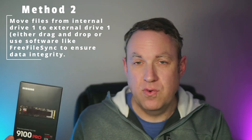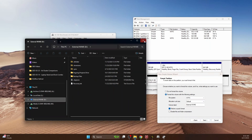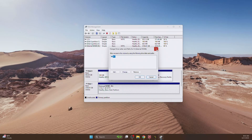I use Windows, and before I could use this I did have to go into the partition manager and partition the drive. When I did that I gave the drive the same name as my existing drive, transferred the files over, then installed it in my computer, took out the old one, and went back to the partition manager and changed the drive letter to match what the old one was.